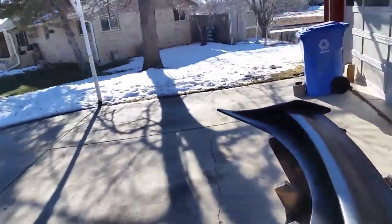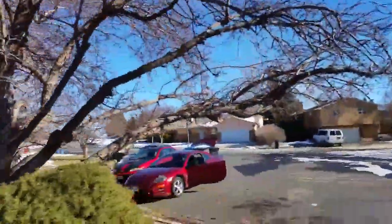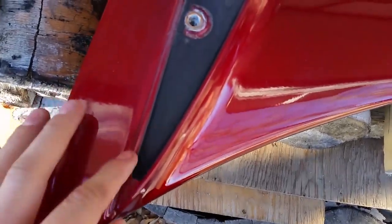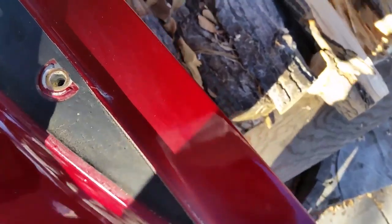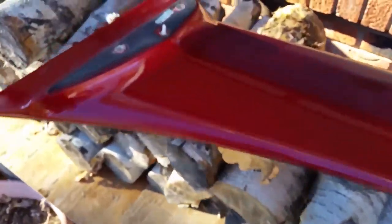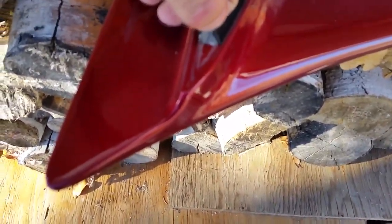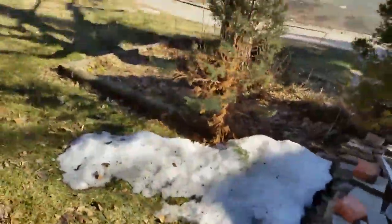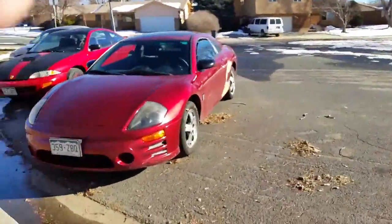That's how you'll replace your spoiler — the old one is really easy to take off. The car looks kind of goofy without it. Once this one dries — it's got about an hour and a half to go — I'll place it on and show you what it looks like. By the way, there's this little rubber pad on both sides. It's just a buffer pad between the spoiler and the actual trunk so it's not sitting there rubbing around and scratching off paint. Peel it up really gently — it still has the adhesive, it'll still be sticky. Stick it over the holes on the bottom of your new spoiler so you don't damage the back of your car.